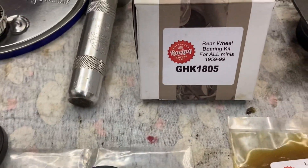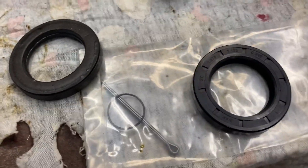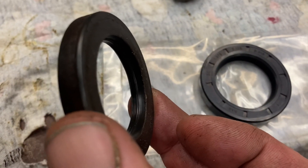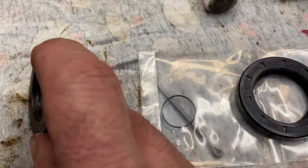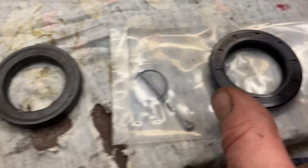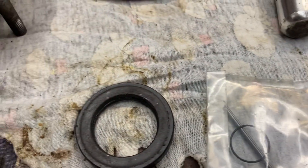The kit I got came with a seal, grease, cotter pin, and an oil ring. Don't skimp — put in the new seal. Not only do they keep the grease in, they keep water out. Very important. You can see this old one's worn out just by looking at the grease side of the seal — it doesn't taper inward like the new one does. Don't be cheap.